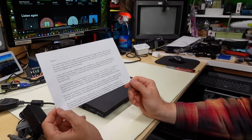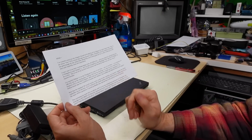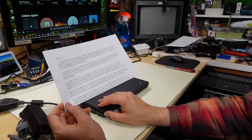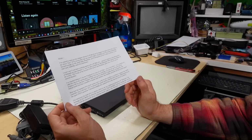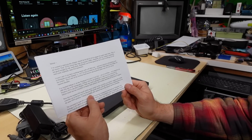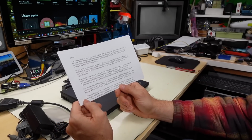Note that the standard XP installer won't work on this machine because it doesn't support the SATA controller out of the box. So I've thrown XP install media with the SATA driver slipstreamed on the spare NTFS partition. I'd probably also upload that to the Internet Archive someday. Oh, well, that's very helpful. Thank you for that. That's really cool, actually.